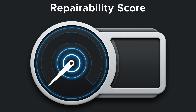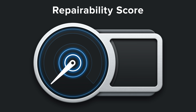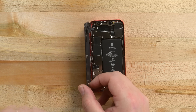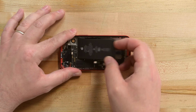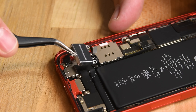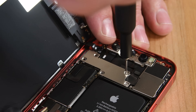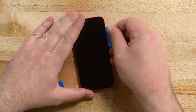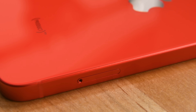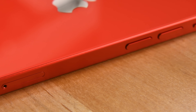The iPhone 12 and 12 mini are so similar, you won't be surprised to hear that the iPhone 12 mini scored the same on a repairability scale as the 12 — a 6 out of 10. The two most common smartphone repairs, display and battery, are well prioritized and most major components are modular enough to be accessed and replaced independently. But, as in all iPhones, there are a number of specialized screws and waterproofing measures that make many repairs more difficult. Worst of all, fragile glass covers the rear housing, which means a single drop could necessitate replacing the entire body of the iPhone.